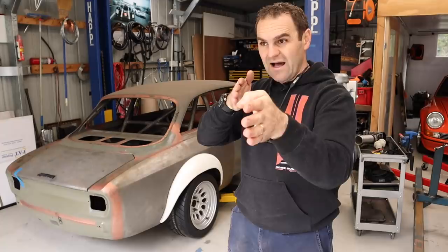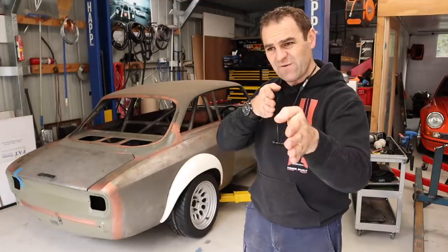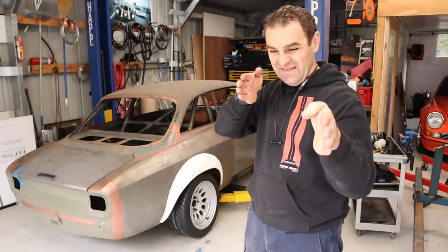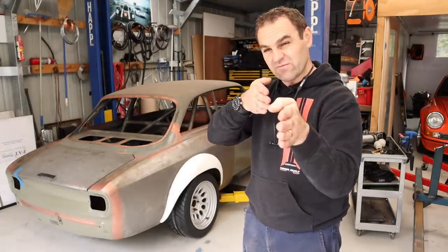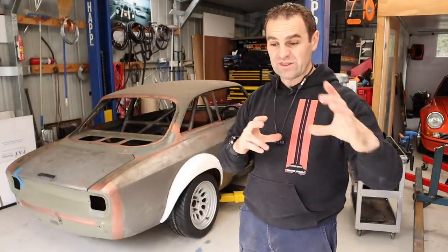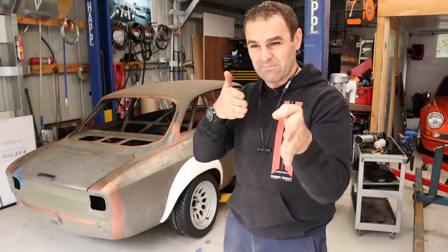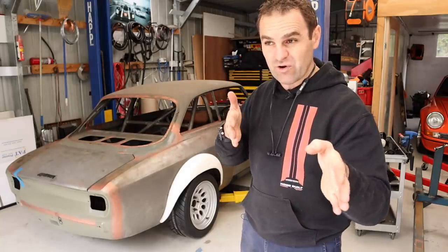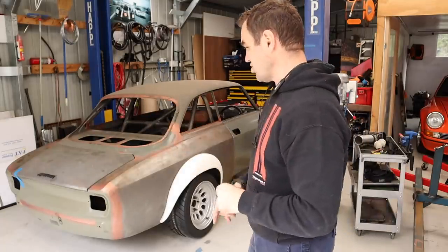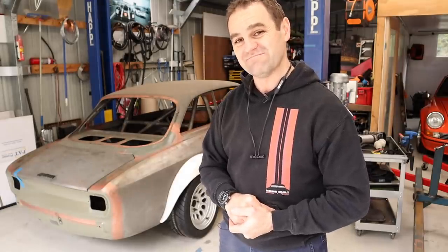Like I've mentioned in the past, when I first put the engine in, the engine and the angle of the diff are not perfectly true, because the diff in the Alfa is offset and the engine is slightly twisted. So it's not the perfect drive line, and that CV along with everything else can help take out some of that drive line vibration if there is any. There should be very little. As I said, my angles are, I think, about 1.2 degrees. Anything over 3 degrees can be astronomically bad and undrivable. I think this should be okay. Anyway, let's get this car up in the air and show you what I'm going to tackle today.